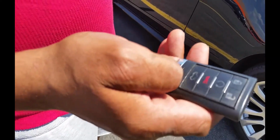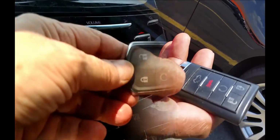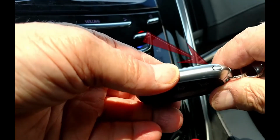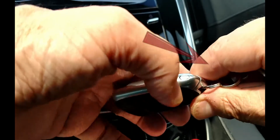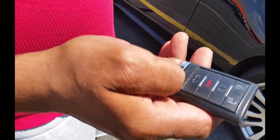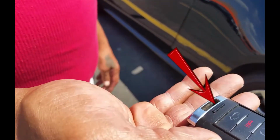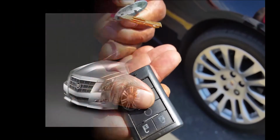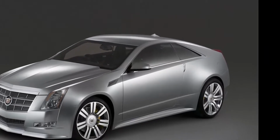The 2 key fobs are either rectangular or curved, as shown, and will need the mechanical key kept inside. The curved fob has a button on the side. Push it while pulling the key ring end out. The rectangular key has a button on the top. Push that button while pulling the key out of the fob, as shown. Now, to find a keyhole.